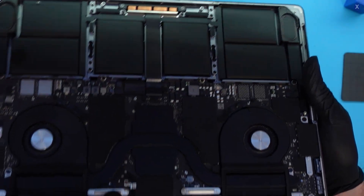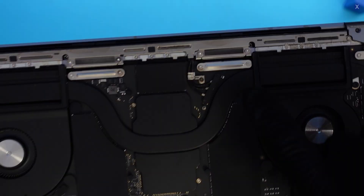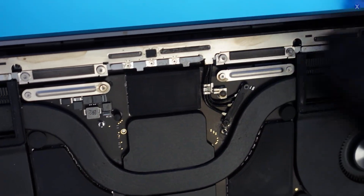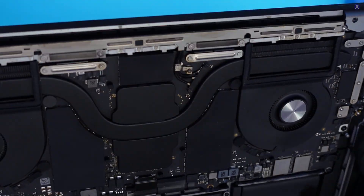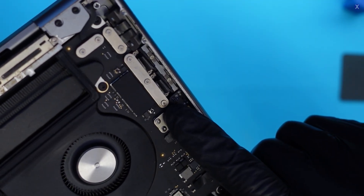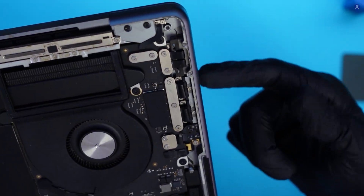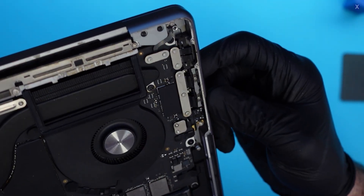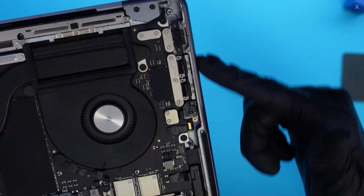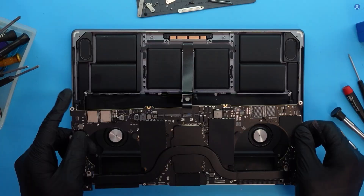We can see there looks to be some liquid impact, at least to the top here, close to where the LCD connections are — just a little bit of browning over the casing. For sure there is at least a liquid spill. Our main concern would be over here, where we can also see there was some impact over the casing. Most likely when inside, because there's crevices and openings for this thing to charge. So I would assume if we open this up, we will probably see some ports may be damaged and probably some damage to the board itself.